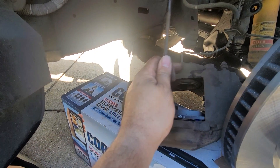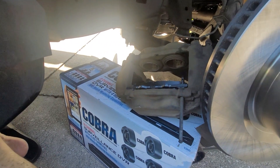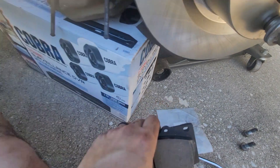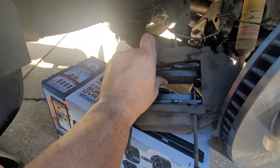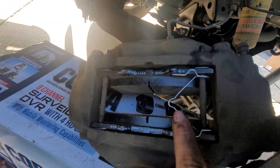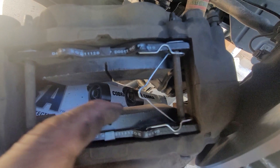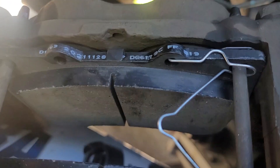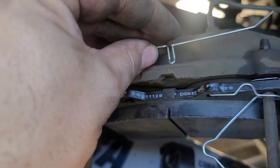Alright, these pins were in — I took that support brace out. This is going to go right in here. Slide it right back in, I'm going to start prepping the bottom one as well — slide that one right back in. Then I'll get the other brake pad — slide that up top, slide those all the way up. Now, I do apologize — I forgot to mention there's this one that goes here, and as you're pushing through it goes through that loop and gets hooked into the brake. Then as you're pushing it loops in here and also gets hooked onto the brake. You're going to see these little holes — make sure this one is able to get looped in here.